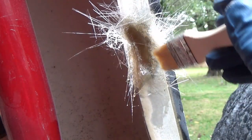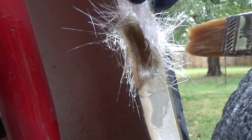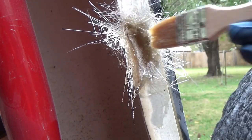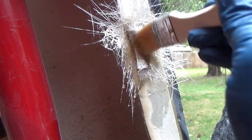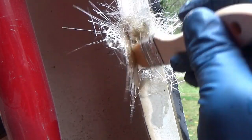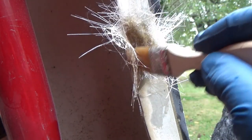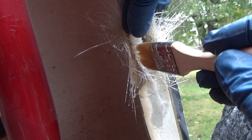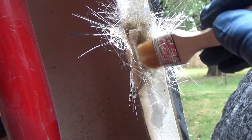I want to point something out. I'm building up on this back edge with some little thin strips that are nice and clean-cut so I can pack them up inside that groove right there to get it built up and filled in, bringing that center section outward to start flushing it out. You see it's white right there - whenever you see white like that it means there's air inside there. Once you get a little bit packed in, get some resin and saturate it real well. That's how you just keep building this intersection up. See that other thin strip - put it right in the middle right there. You don't want to keep building up on the sides because that's kind of wasting resin and creating extra work.